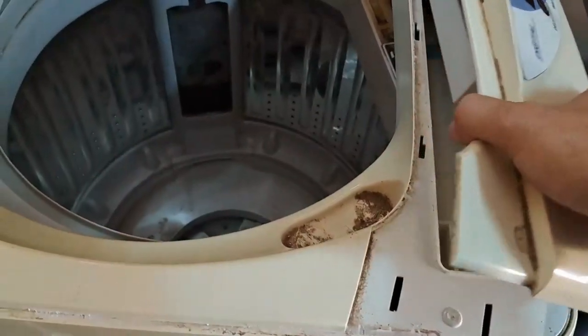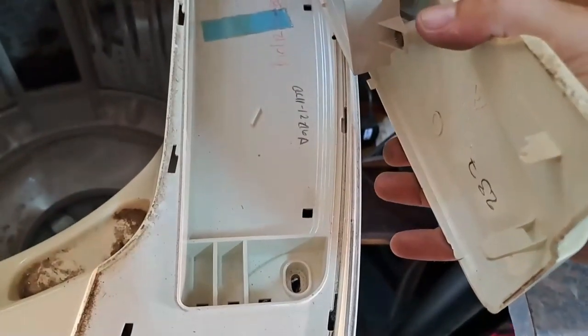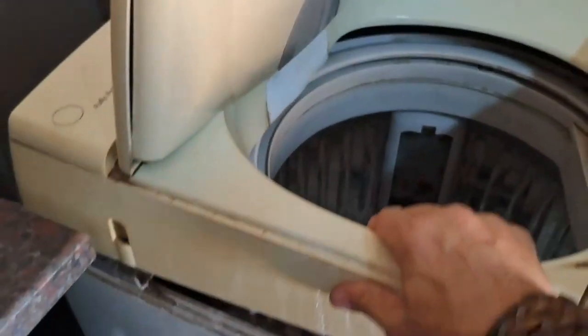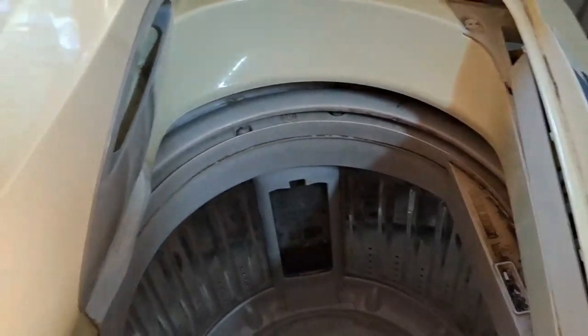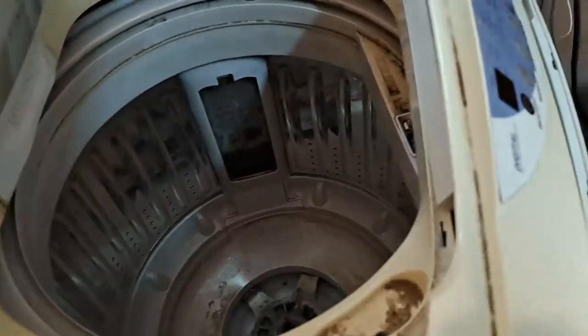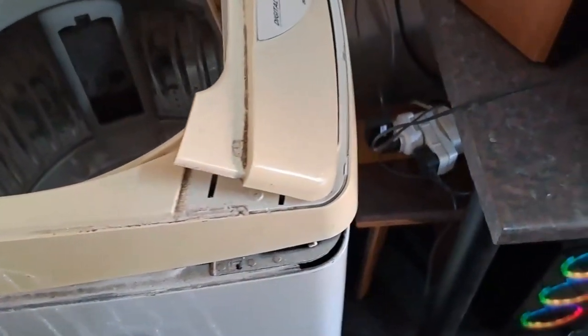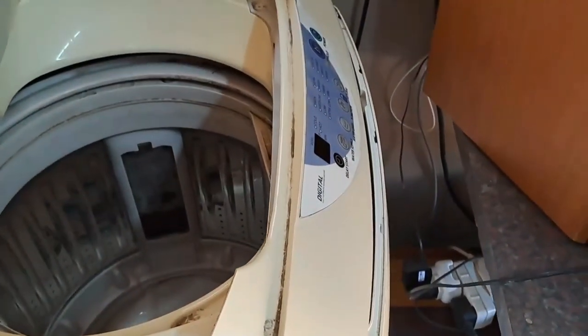Okay, quick update. There are some clips holding this panel in place. Once we remove this panel, there are two bolts — one there and one there. Then you loosen them, and then here at the back, there's a bolt below and another one. Once you do that, the whole top is loose and we can move the top to one side and take the drum out. This was very brittle, so some of the clips broke. I will repair it with some glue and glue this back into place once it's cleaned and looking good again.